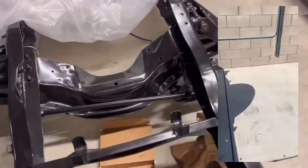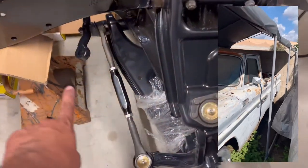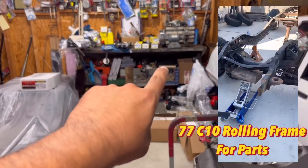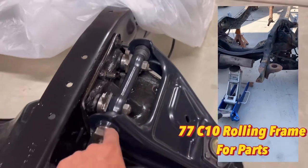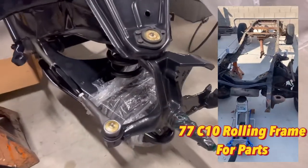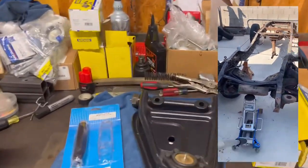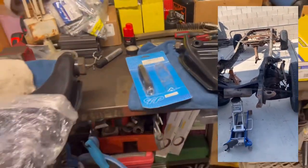We got a little progress — I just wanted to make a quick video of what happened and hopefully it helps somebody out. Pretty much it's Rust-Oleum 215, everything's powder coated. The arms — I ended up saving all my shims and hardware, just ran them through the wire wheel brush. I bought new grease boots for the arm nuts. I got regular spindles with drop springs in the front. Hope you guys like it, continue on this side, stay tuned, like and subscribe if you want — I'm still gonna make them. Thanks a lot!